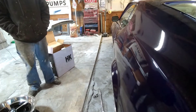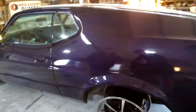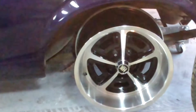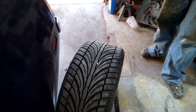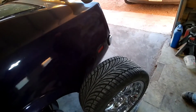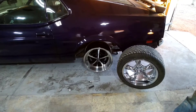That rim does come out here and fit the fender well a lot better. What do you think now that you got it on there? I like it a lot. I don't think we're going to be able to fit a 315 underneath the back of this car without moving the leaf springs in and all that mess. I think it's going to start rubbing the inner fender well — not going to be enough room. You're just going to have to live life with a little skinny 275s. We're going to get the front one on here just to see kind of what everything is going to look like.